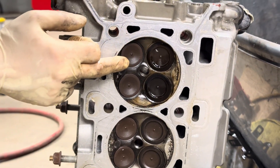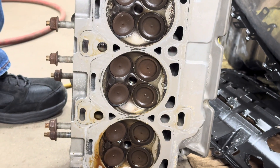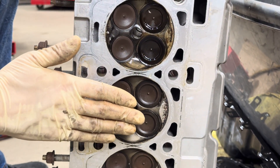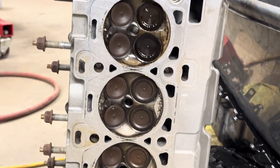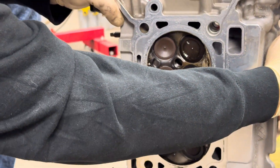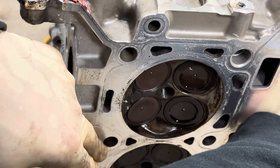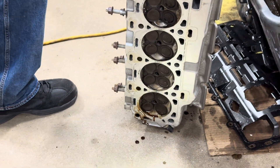There's some aluminum chunks that made their way into the combustion chamber. Looks like all the valves are seating — well, with the spring tension against them it can kind of pull them tight. This one might not — let's try something real quick. Oh no, it's bent. See, look right here. Yep, yep, yep. So that one's bent for sure.